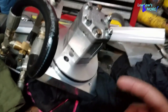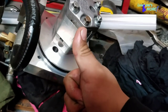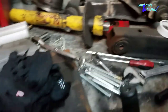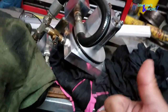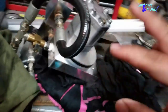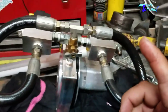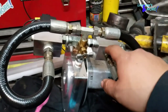I've got the gear on and the o-ring on the block from the gear to the block, so we've got a good seal — shouldn't have any more problems. Those old school blocks are really not worth using with new gears unless you have a machine to grind in the spot for an o-ring to sit. Now I'm just gonna put the tank and motor back on and it's good to go back in the MC so I can finish tucking the wires. Some people ask why not use thread putty or thread lock instead of Teflon tape.